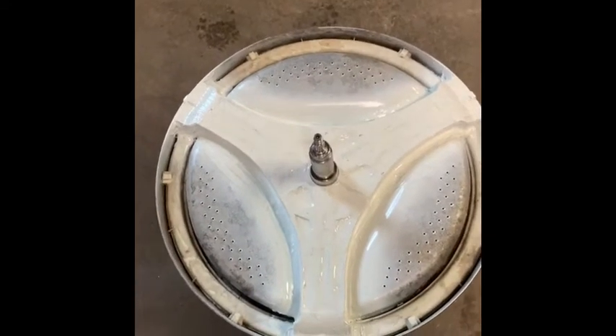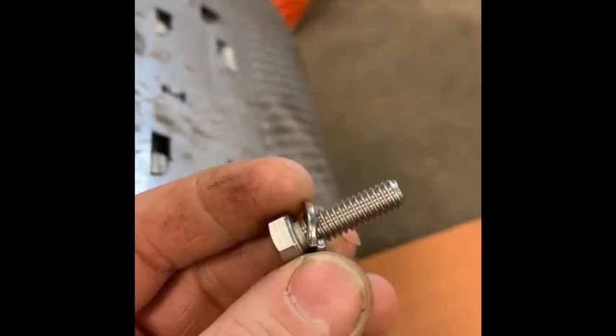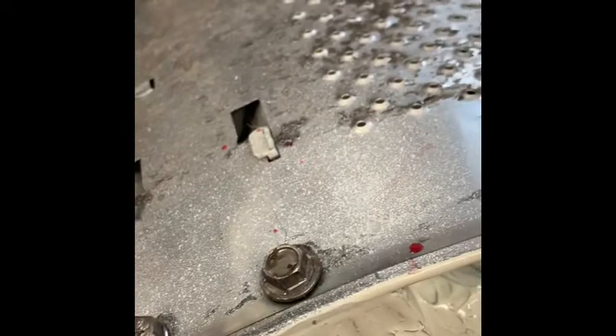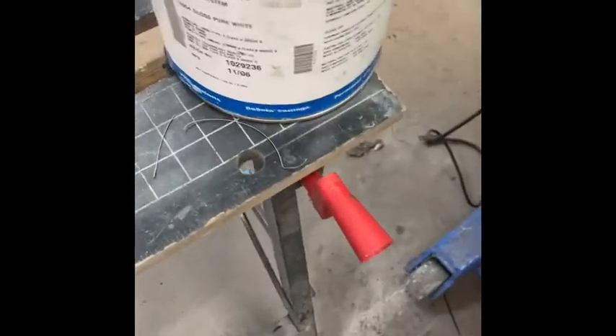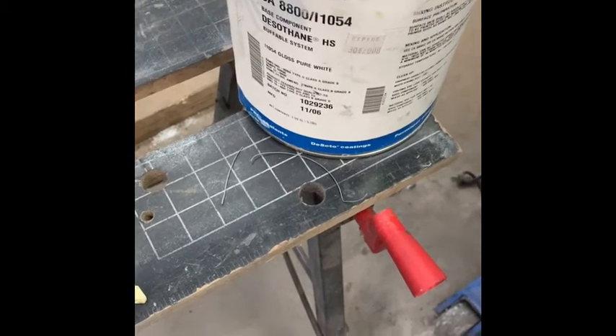Next will be the high-speed test. The bolts are just stainless steel from the hardware store with lock washers, 5/16". That's the tap I used to re-thread the casting. Here you can see a 5/16" next to the original 10mm — probably M8 — and the dimensions are pretty much the same. Once torqued down I also put some Loctite in there, so she should hold. The paint is a PPG product — a very good polyurethane paint, three-part mix with a hardener and thinner to spray it.